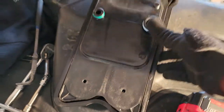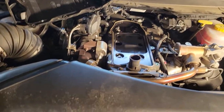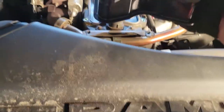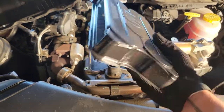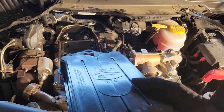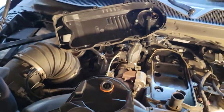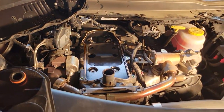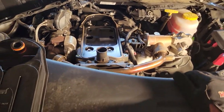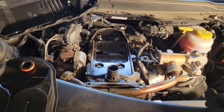Insert the new filter as shown after wiping everything down. You're gonna match the shape — Fleetguard with the Cummins logo up — and give it a nice press until these bottom valves with the o-rings snap right into place in those slotted holes. After that, reseal the engine, cover it up, and bolt everything back down. Do not over-tighten because you're going to be doing this frequently. I use this truck for commercial purposes so I will be doing this quite often.